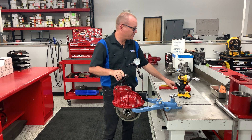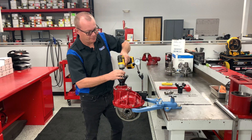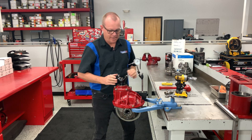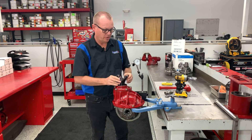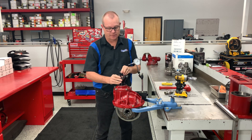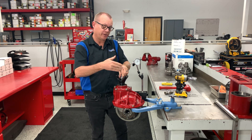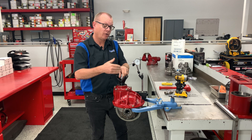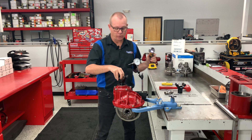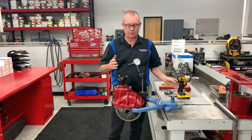Once they've established a spot, we take the tool out, take the pinion yoke off, and the technician marks it. Then we'll go 180 degrees and recheck it. If it's more, we go back to where we were and go 90 degrees and measure it there. We'll keep doing that until we find the minimum amount of runout.